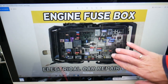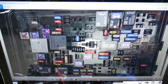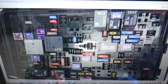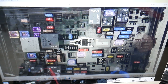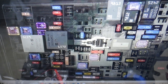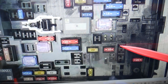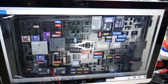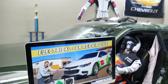Now let's zoom in to clearly see all the fuses and explain which two fuses to check for the transmission auxiliary pump. You may or may not have these depending on your engine model and transmission. The first one is fuse number 57 — if you have it, it will be right here. The other one to check is fuse number 92, right here in this row. Most of you will have either one or both of these if you have a transmission auxiliary pump. Hopefully this video is helpful — thank you for watching, see you next time.